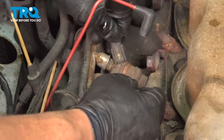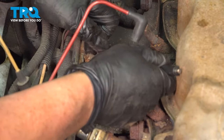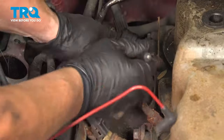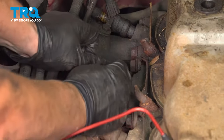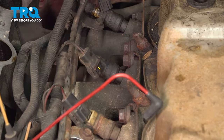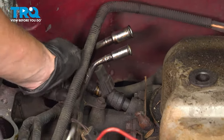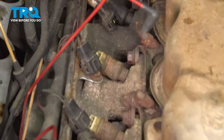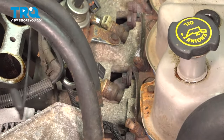This one has both tabs, so while you're pulling on it and giving it a slight pull, you can push up on both tabs and it'll come right off. Note that on this vehicle the emission tube has been removed already — if yours is still on, you'll need to take that out to get the injector rail up. Last one — now we can pull the harness aside.